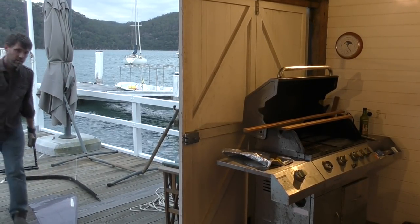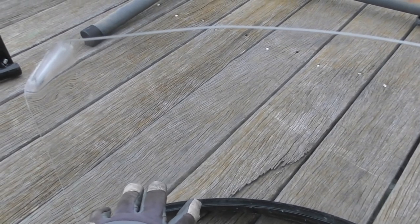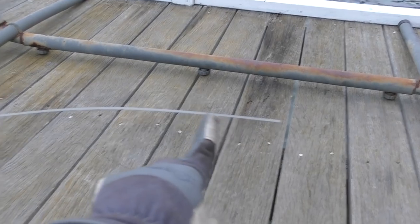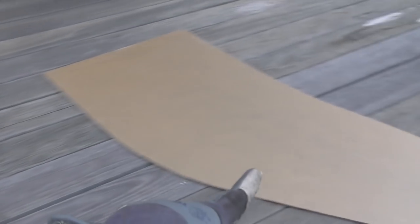That's cooled down now. I was thinking this looked pretty distorted, but we'd actually bent this edge and put another crease through it in the workshop using the heat gun to see how well the heat gun worked. Even just having it on the barbecue for a bit, it was not molten or anything like that, but definitely soft enough to fit in the curve of the frame for the windscreen, so we might be onto a bit of a winner. I think we give it a go with our real piece.